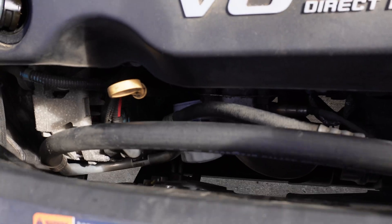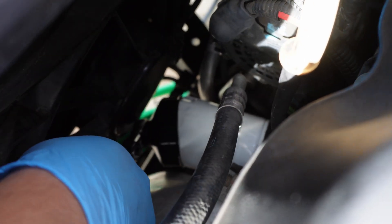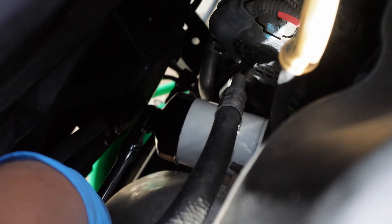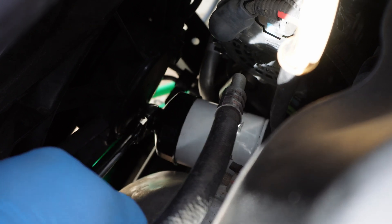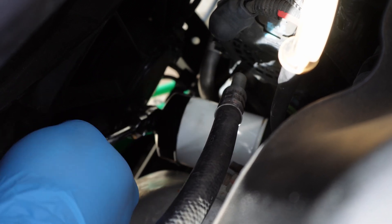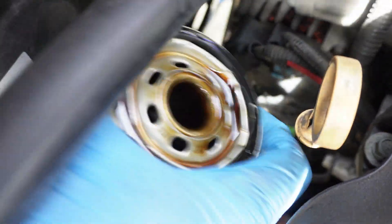Back on the top side of the car, the oil filter is located here. The good news is that it's a spin-on, so it will be super easy to replace. The bad news is it's at a bit of an odd angle, so we're going to remove it from up here to avoid oil dripping on us from below. I'm using an oil end cap wrench, but a strap wrench works just as well, if not better, as you'll see in a moment. It's a little bit of a struggle to find the right angle to get the ratchet in between the oil filter and the radiator fans. As we get the oil filter loose, make sure the oil pan is shifted to catch the oil coming out of the filter.